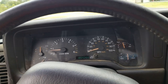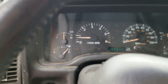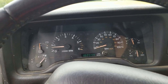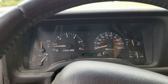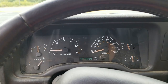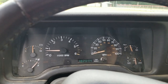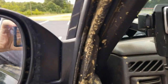Just driving around a normal corner in town, they're really not that loud, but at low speed you will definitely hear that bang and pop and unlock. I'm using 80W-90 gear oil, which is the same as factory. Some people bump up to 140 gear oil, and they say that makes it a lot quieter. Jeep actually recommends that for heavy towing applications or extreme weather applications like super high heat. But I went ahead and just did the standard 80-weight.